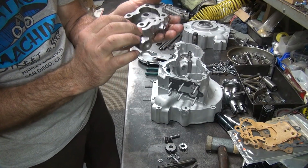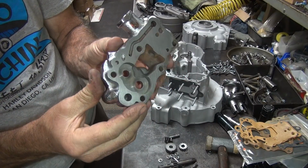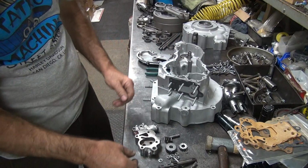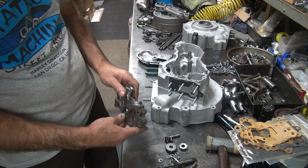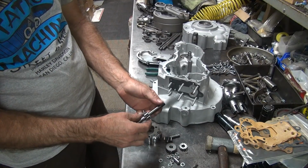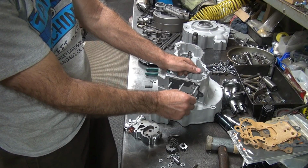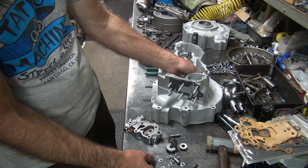Why it's doing that, but it is. This side over here looks okay. Alright, so that's our drag issue. It's on the big gear. It's on this shaft hole here. The shaft locks up in there with a key.